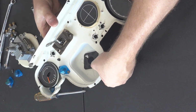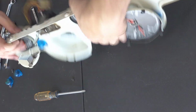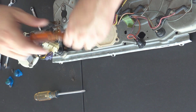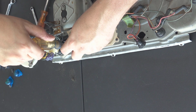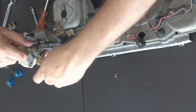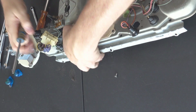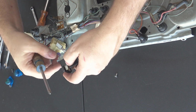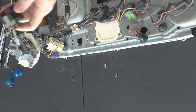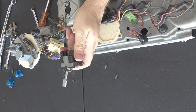That's held in. Looks like all the screws in the back are held in with some sort of gasket thing. So I've never taken this whole thing apart. I'll deal with that later. It's just all messed up. Okay, so it's out. Let's go ahead and get the wiper switch out. Oops, that's actually a Phillips head screwdriver. So one wiper switch. Now the wire harness does not come with a new one of these, so you'll have to reuse your old one or buy a new one.